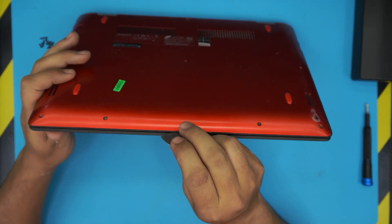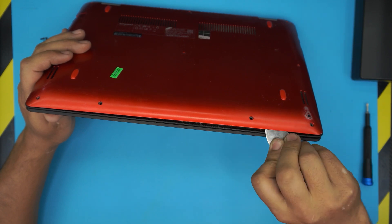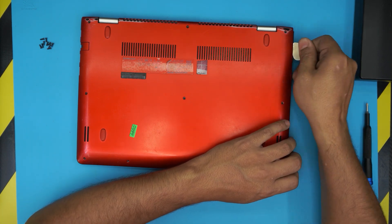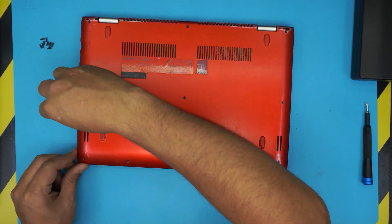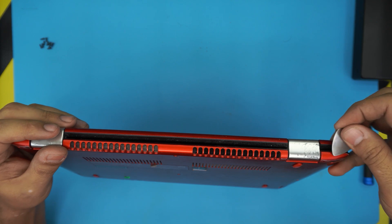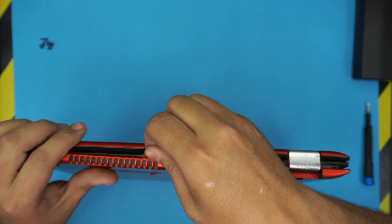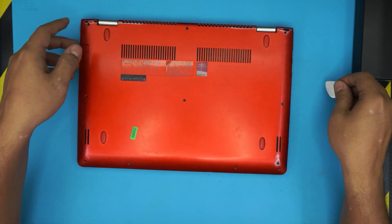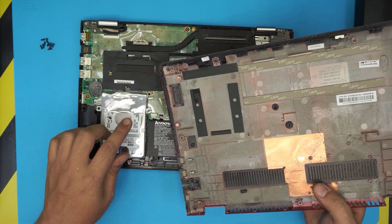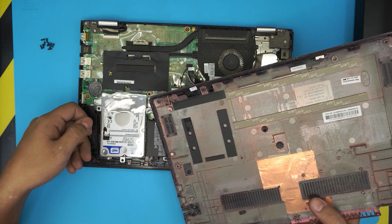Stick the opening tool between the top and bottom cover about one to two millimeters, then twist it around — you want to hear some clicking. Those are the snap points, so go all around and make sure you hear those clicks as you lift it up. Do the front, the sides, and then the back corners where the hinges are. Once you loosen all four sides, lift it up and wiggle it. Sometimes it won't come out easily because of a sponge that gets glued to the hard drive from heat and overtime use, so you may need to yank it up to separate the foam.